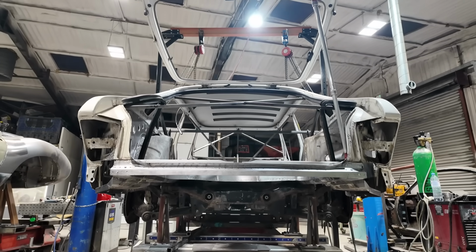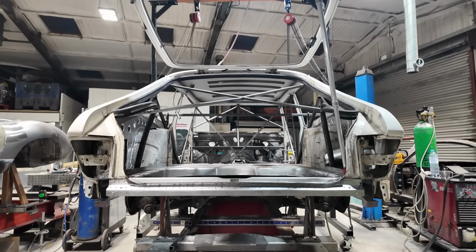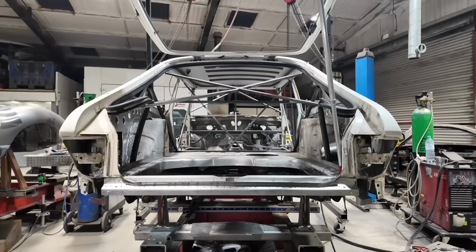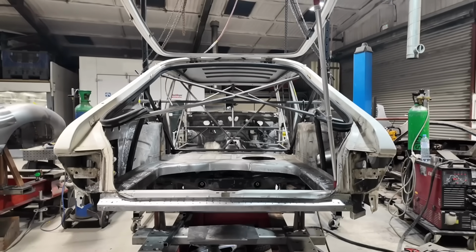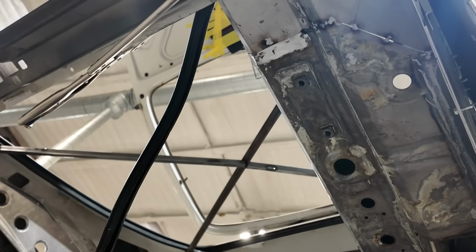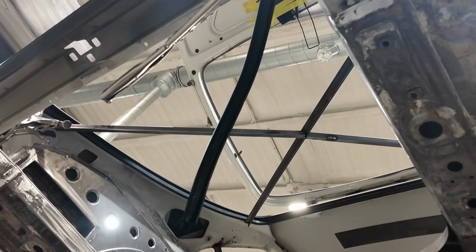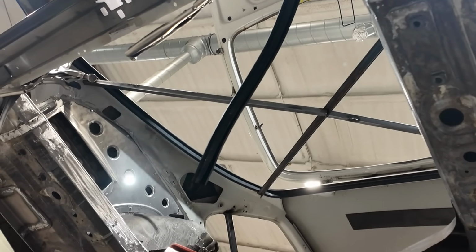And then at that point, once the strength was back in the rear end of the car there, Bobby's removed the spare wheel well from the Audi half portion of the body shell, trimmed all that up, trimmed all that off and got all that cleaned up, and then he's made a new corner section in the front left-hand corner of that to give that symmetry.